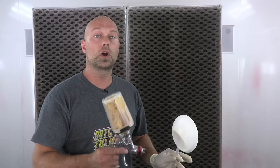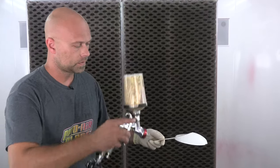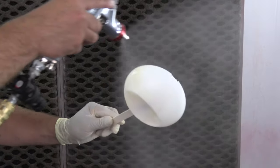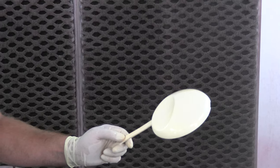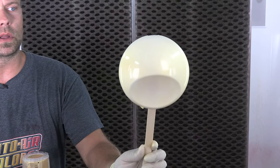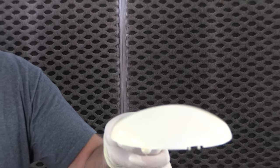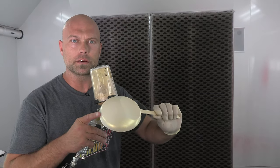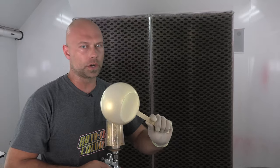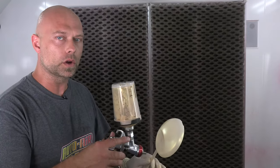This is going to be applied the same way — about two coats, let that dry, maybe one coat just to make sure the orientation is nice. These are all reduced right around 10% with our 4011 reducer; 4011 is our go-to across our entire line. One nice medium wet coat — doesn't look like a whole lot right there, but it will. The second coat's really going to fill that in and it's going to look awesome. Coat number one is dry — dry to the touch. Every single one of these, you want dry to the touch between coats; you don't want it a little wet because it's going to cause problems.